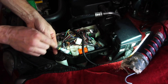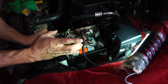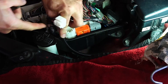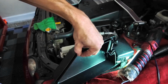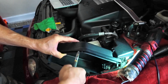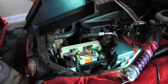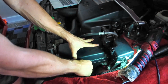Go ahead and make a spot for the wire harness to come through the glove box, and run it right through there. You're also going to have to cut the lid, so make sure you mark the lid — otherwise you'll sever that wire. Make sure there are no sharp edges in there. Let's see if that did the trick — yep, that's the routing you can see going all the way up right into the firewall.